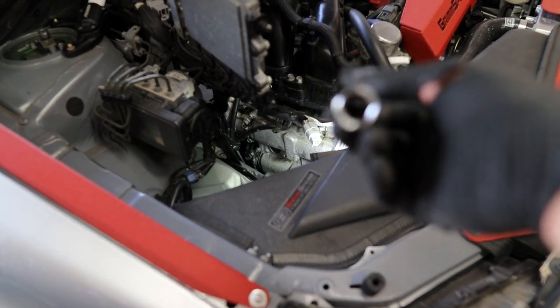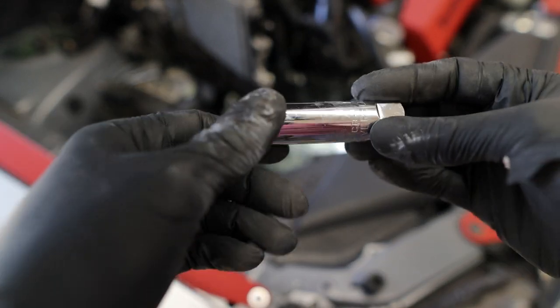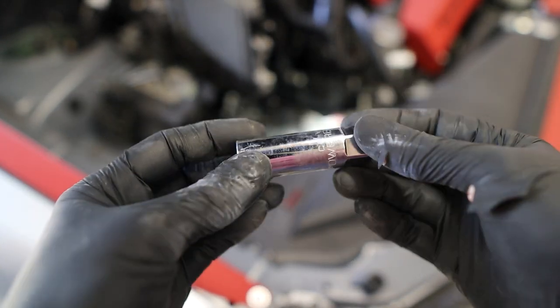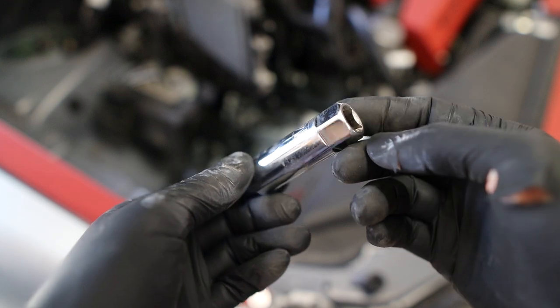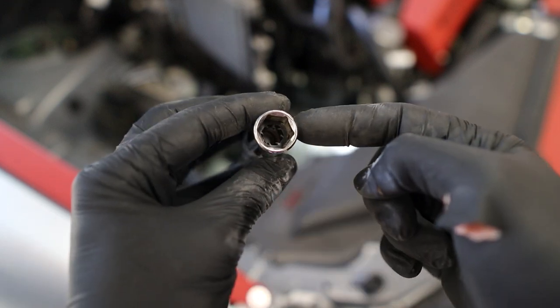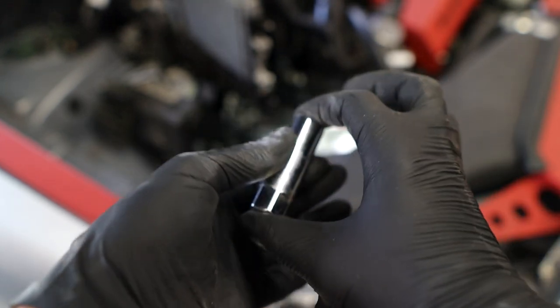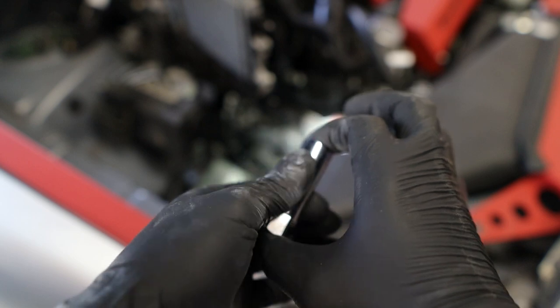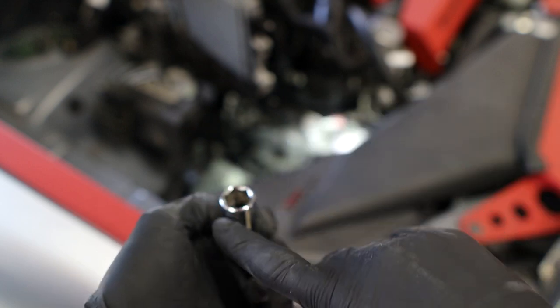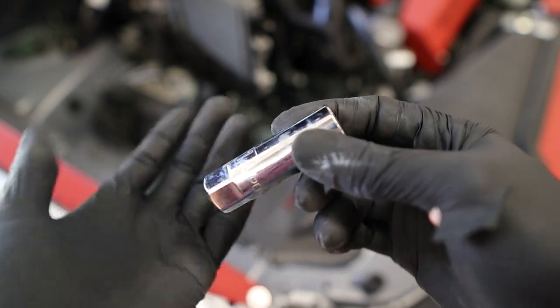So this is a spark plug socket tool. I'll leave a link for this in the description. This is a 14 millimeter. As you can see, it has a little retention rubber piece on the inside so that when we put this onto the back of the plug and take it out, the top of the plug will be retained by that rubber piece in there, and you can just pull it all out without dropping it.